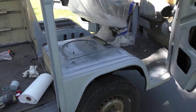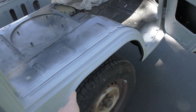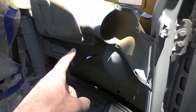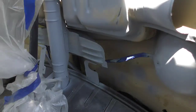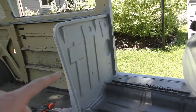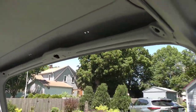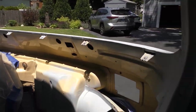And then finally, to finish out the cabin area, all these areas were primed, filled anywhere where I needed to do some filler work or glazing work, spot-primed any of these interior pieces that are going to show through the panels — getting the rust and paint off — and finally doing all the seats, jams, and everything inside that's going to get painted is now primed.